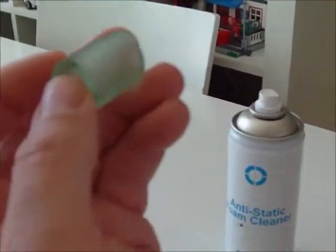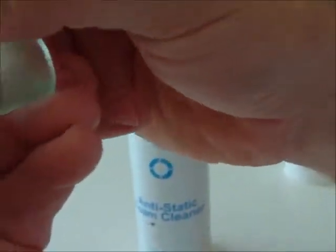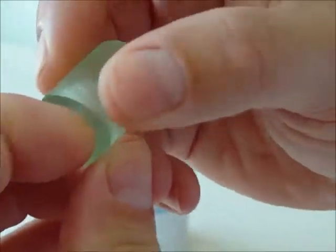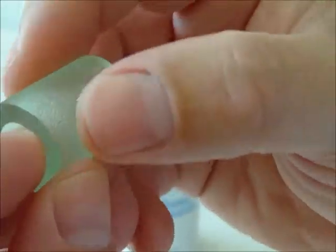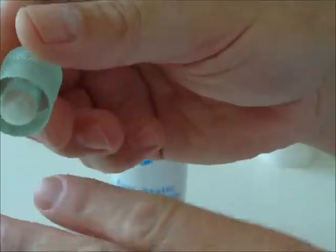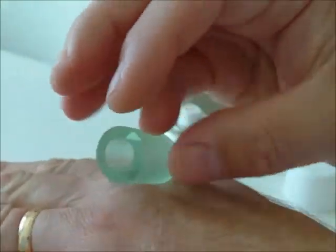And the reason is, if you look, I don't know if this is going to show on the camera, the tread pattern, but if you reverse the tread pattern, it's a little bit rougher on one side than the other. I can usually tell just by feel, but ideally you want the smoother side going in the paper pickup direction. This would be your paper going through.